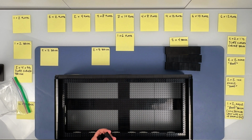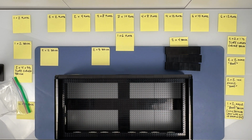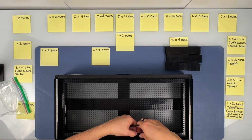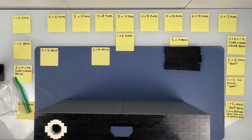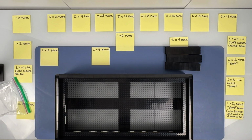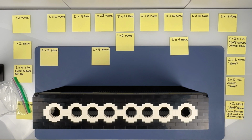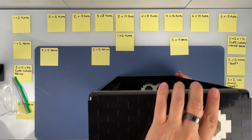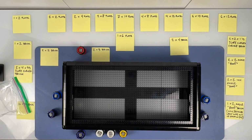One other thing I want to mention about the extra large hole that I built in the back. I was talking over it, but you'll see when I angle the back of this thing up, there's an extra large hole there. You could actually probably make that just the same size as every other buttonhole if you were so inclined. The reason that I did that was just so that you could fit whatever cables you needed to run in there. In theory, you should only need to run maybe 1 cable through there. But if you try and put a Raspberry Pi or a little single board computer in there, or, if you're a crazy person, a power adapter, you could do that, but you'll just want to be careful about the amount of weight that you add onto those weak base plates in the bottom of this thing, because it can pull the bottom out from underneath this.